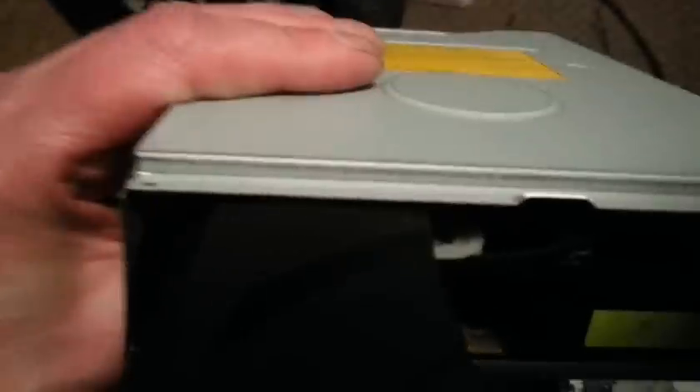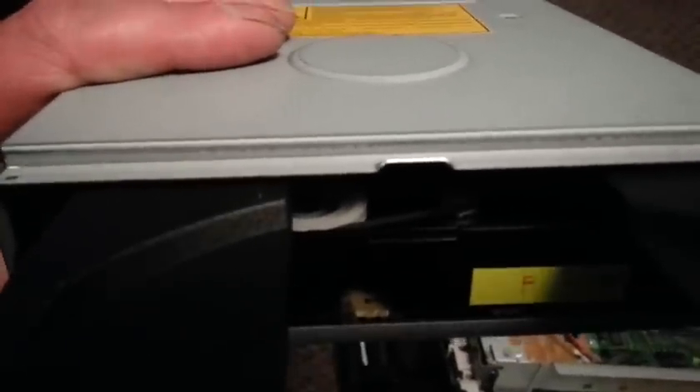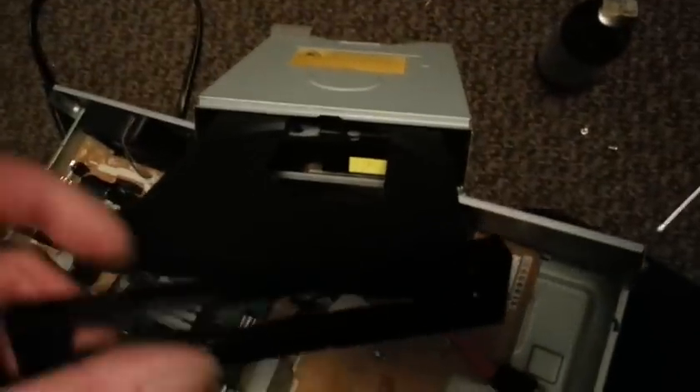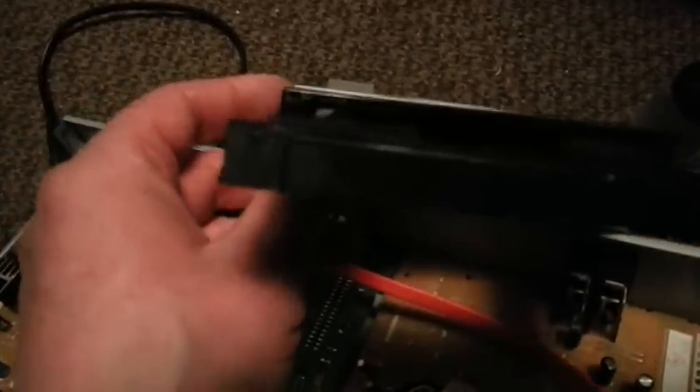Through the magic of editing, I wanted to show these belts in here — that's for the drawer. You'll see two pulleys and a belt in there. When your drawer is sticky, replace that belt. There's usually a front cover that goes over top of this. You had to get that front nose off to get everything in place. Most of it just snaps in place, so you just have to analyze it. Don't force anything — if it's not coming apart easy, you're not doing it right.